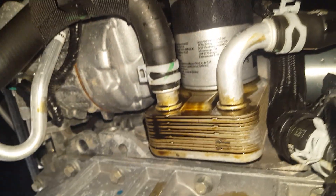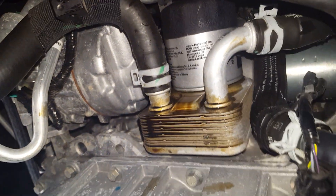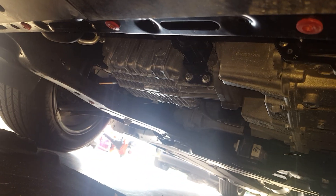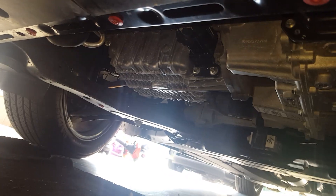I always like to take the oil filter off first before draining the oil, because oil filters can be a bear. Now go ahead and take out the drain plug. I've already drained the oil and got the bolt back on, as tight as I can with the ratchet. You do not want to take an impact tool to it — just get it on there as tight as you can with hand and a ratchet.